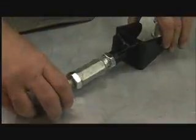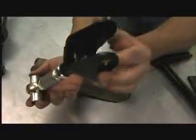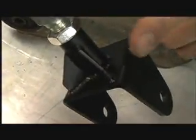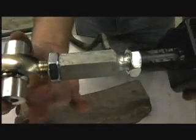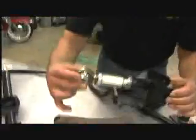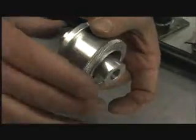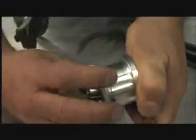The upper control arm, if you ask me, is the one that really takes the brunt of the abuse. And if you take a look inside of this one, they've actually bored a hole through it, welded the inside of it on the outside of the tube, as far as welded the outside. And then they also have 2 gussets on there. There's also an adjuster in here that has left-hand, right-hand thread, so that all the adjustments for the pinion angle can be done while everything is still hooked up in the car. Really a neat setup. The rear end usually has worn-out rubber bushings on there. TRZ supplied the spherical rod end bearings that are really neat because they press into the stock location and then you just tighten them up like that. That's a really trick arrangement.